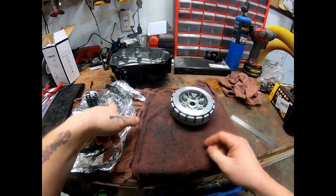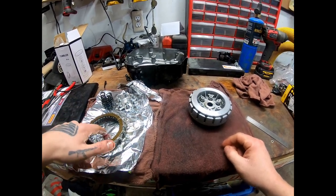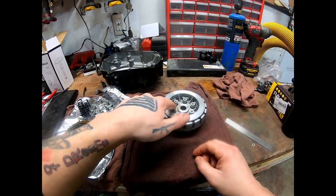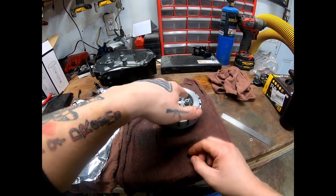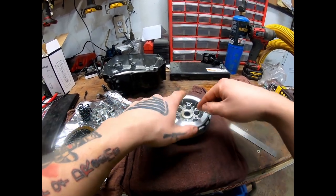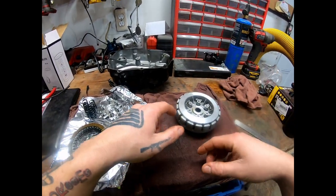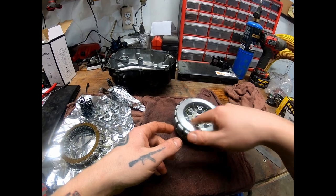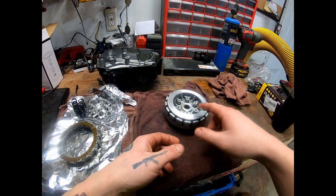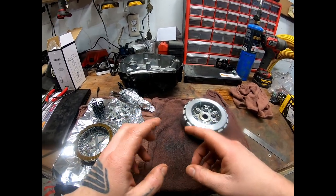Here's how you remove it — the whole thing comes out. I have my new clutch plate from Man in the Box, same as Chimera. I have all new bolts, my six-disc clutch pack from SMR, and 60% stiffer springs from SMR. I tapped my pressure plate — it's an M6x1.0 tap. You do have to drill a little bit to get through the metal plate behind the hole. Or go to GrandBeardo — he'll give you a whole new one with six bolts for about 30 to 40 dollars shipped.